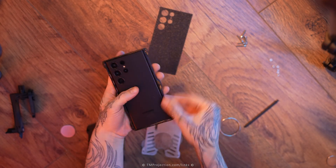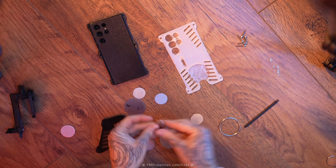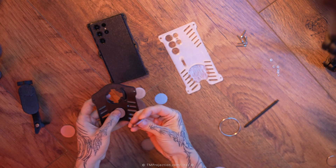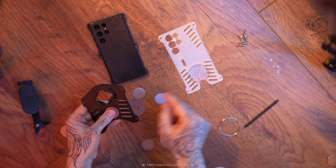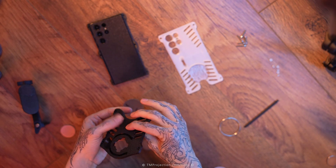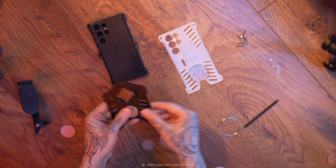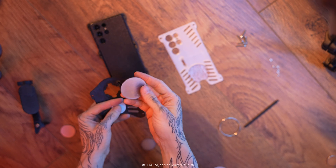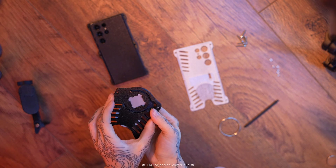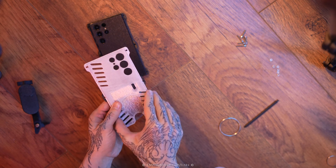So you would put the phone in here, and the plastic cover which fits very nicely here. We've got the back here, and I want to check the magnetism — which way does it connect? It connects like this to the mount. So the magnet will go in first — this is 2mm thick by 30mm wide — and another one, which totals 4mm in total. So: 25mm wide, 2mm thick N52 magnet, followed by 4 layers of 30mm by 1mm 430 grade stainless steel circles, and 50mm wide by 1mm thick 430 grade stainless steel circles. Then the aesthetic steel piece goes on as well.